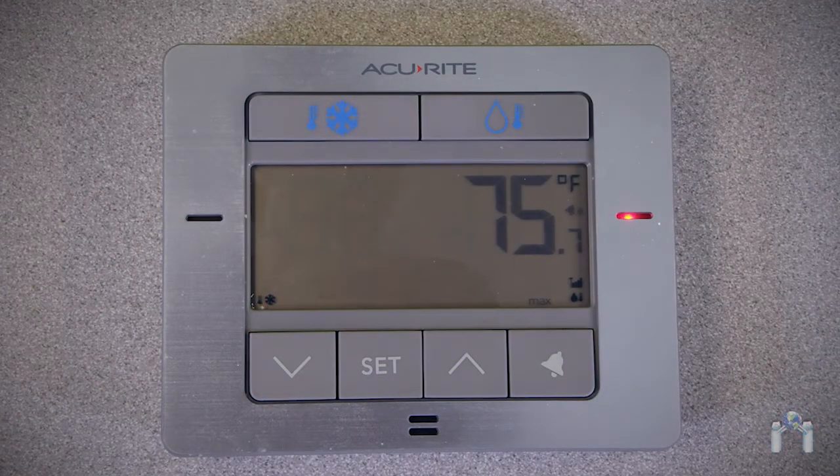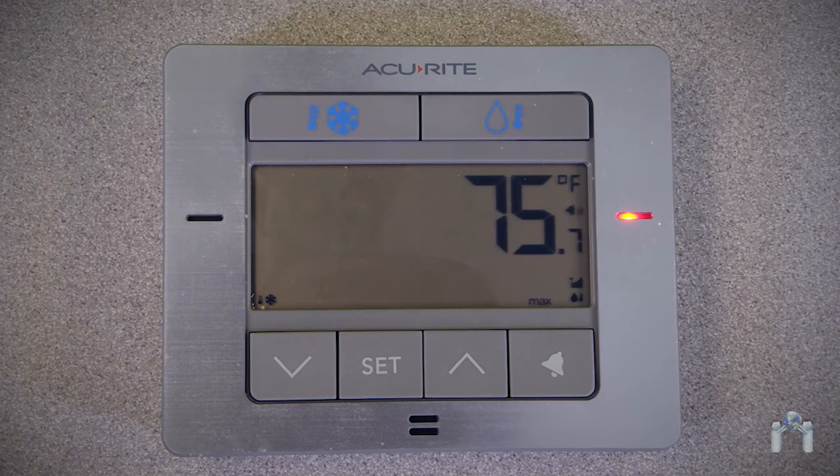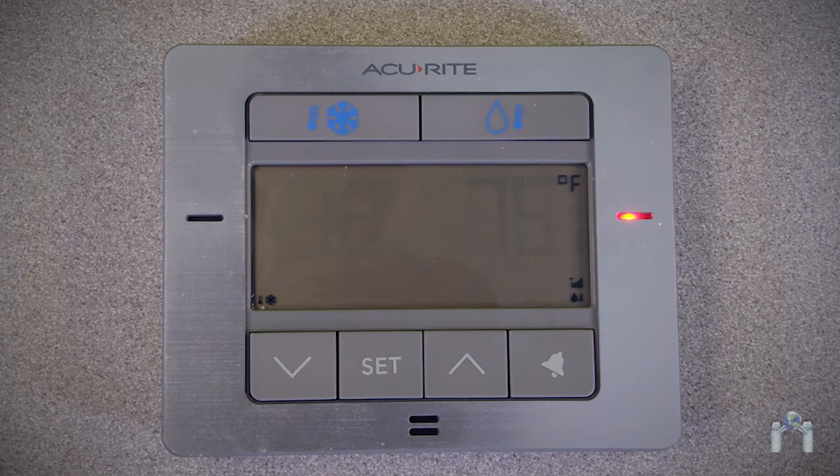The display can be configured to set off an audible and visual alarm when temperatures exceed the preset minimum and maximum range. An alert is triggered when a temperature is out of range for longer than 5 minutes. This prevents false alarms due to the refrigerator or freezer door being held open while new items are being loaded or unloaded.